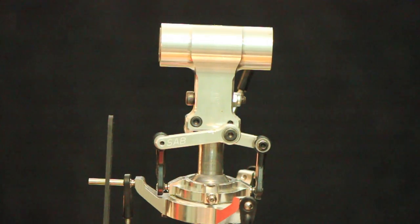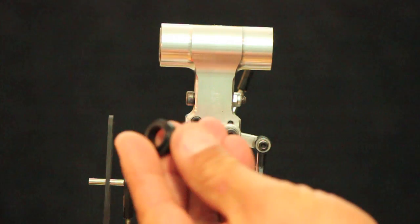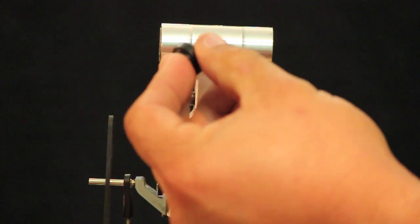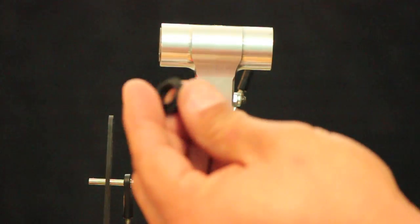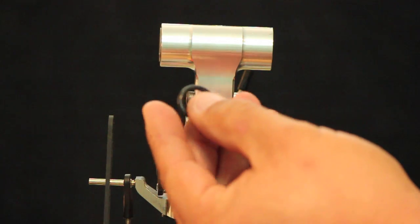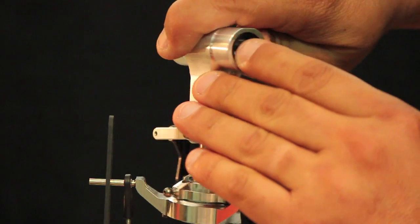As you start building this, you're going to find in the box an O-ring — actually several O-rings — and you're going to find the actual dampers, which are nothing more than a piece of technopolymer plastic. It is very strong and does not give at all. What provides the dampening is the O-ring itself, not the damper — the damper serves more as a limiting device. Take your O-ring and use some synthetic grease. Make sure it is not petroleum-based because it will eat it up over time. Grease it up well and then stick it inside the head block.